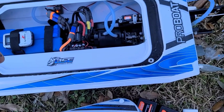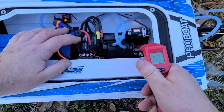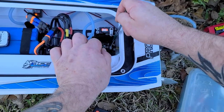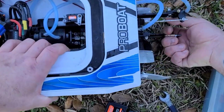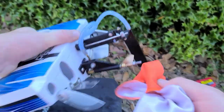See all that smoke coming out — that's not from the motor or ESC, that's from the collet. I'm pretty sure this collet is notorious for doing exactly what you've seen happen. What it does is just kind of get stripped out, loosened up in there, and you lose grip on the cable. The prop is sharp, and you lose grip on the cable.